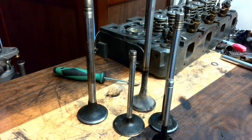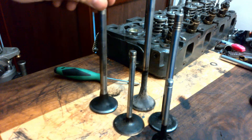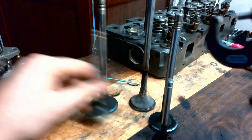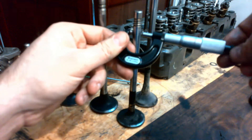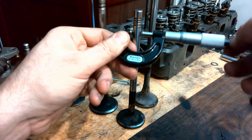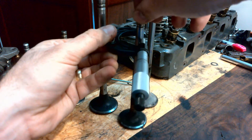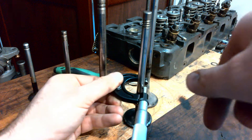You can do a runout — put it in your valve grinder machine and see if it runs straight or if it wobbles. It should run relatively straight. But we do have to inspect them with our other favorite tool, the outside mic. Most OEMs are going to give you a few measurements. Take a measurement up top here, turn the valve 90 degrees, take it there and get it out of round. Do it in the middle, do it at the bottom.